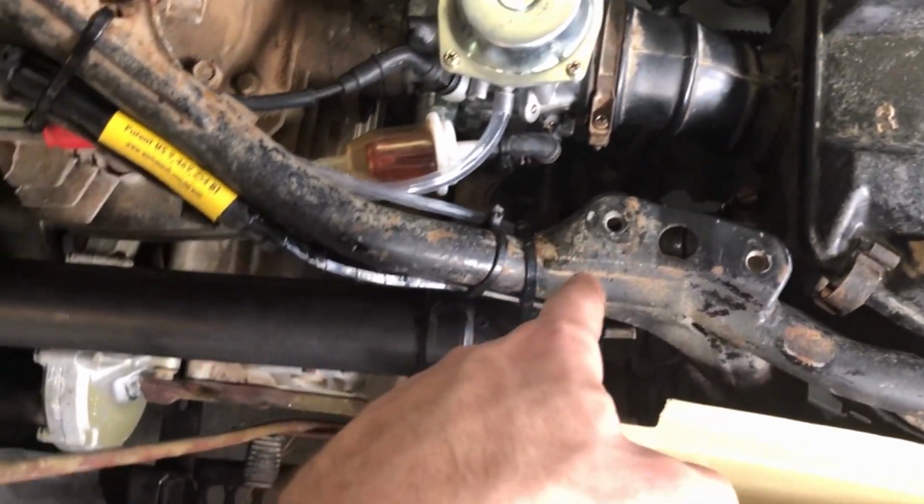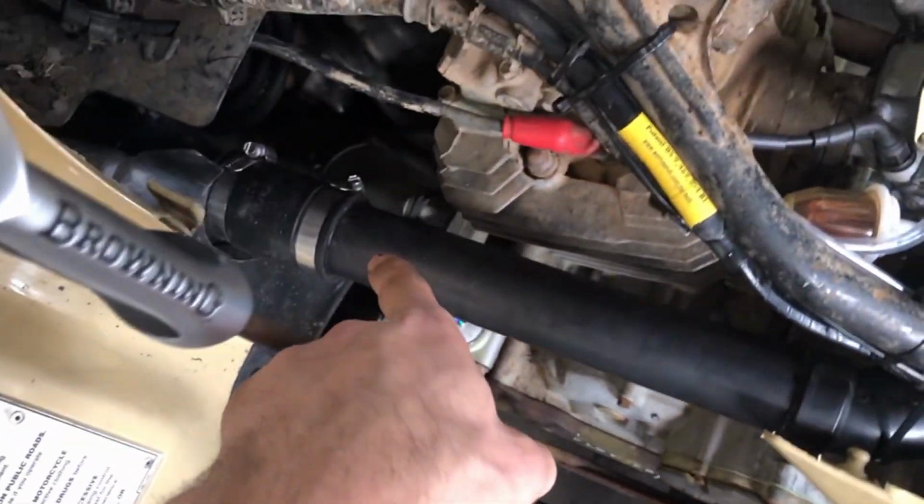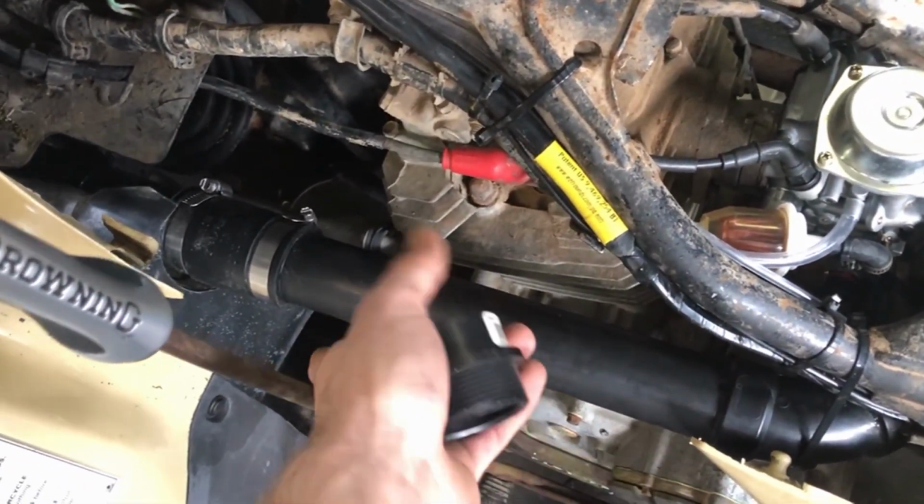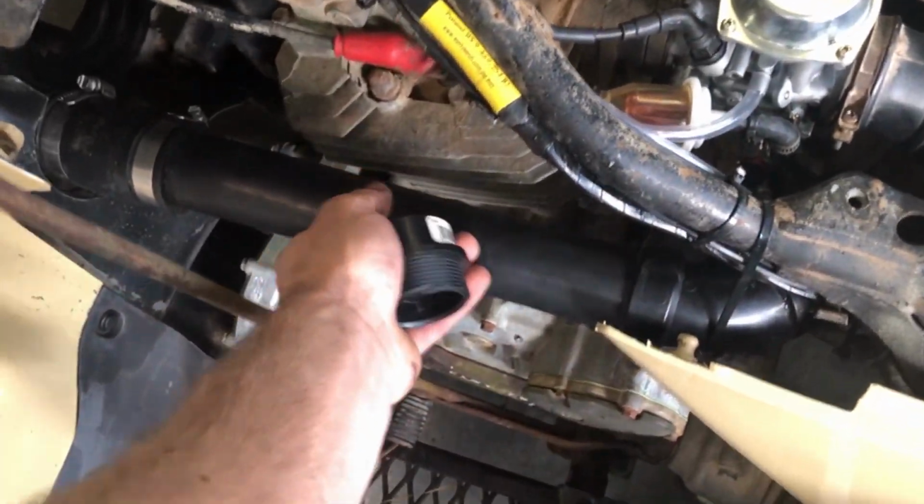So take a street 45, another street 45, go straight. You want to put a boot just in case you ever have to do any engine work, put a new top in or whatever. You can just unscrew the boot, take the air box out, take all this out, then you have access to everything.